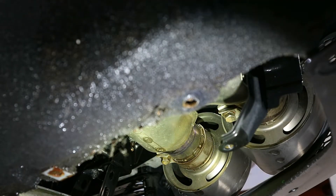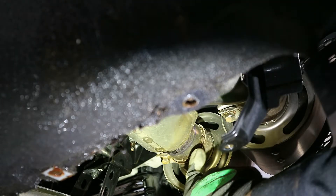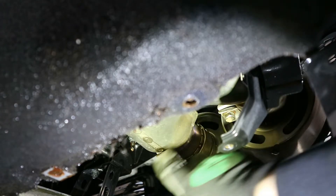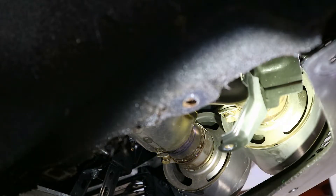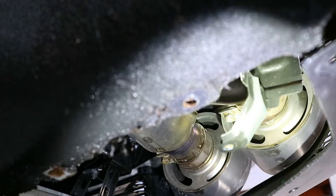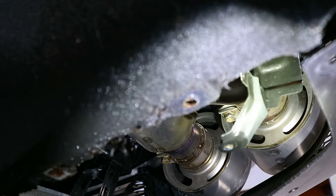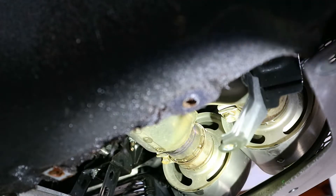From the rear section, there's a bolt there and there's another bolt there. It's basically just these two you're looking to remove — you don't need to remove them all the way. You can just get them loosened and the actual tailpipes slide off from the other end. They are 13mm, so grab the 13mm.